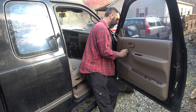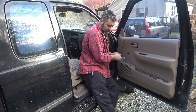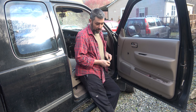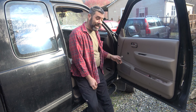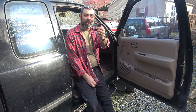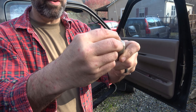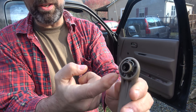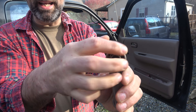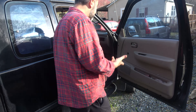And then lastly there's the window crank. I'm going to go ahead and try to remove it. There it is — losing that little spring would be a bad idea, so let me grab that before it disappears forever. We have our window crank and this piece right here — it slides down into this slot. When you go back together it just pops on, but it sits in there, so you'll take a hook and kind of pull up on that to release it. If you just pull really hard you'll actually break it, so don't do that.